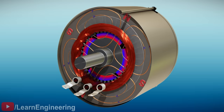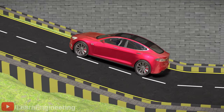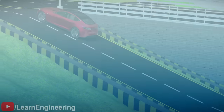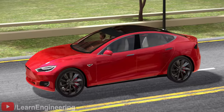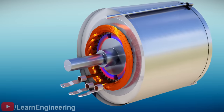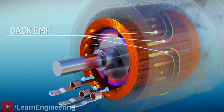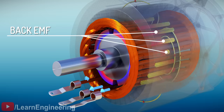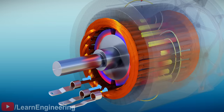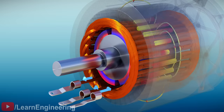But the search for the perfect electric motor is not over yet. A permanent magnet motor produces good torque when you start the car or ride up a hill. However, when the car cruises down the road at high speeds, permanent magnet motors have terrible performance. The villain here is the back EMF. The magnetic field lines produced by the permanent magnets link with the stator windings and generate an EMF there. This back EMF is clearly a reverse voltage to the stator's supply voltage — the higher the rotor speed, the more back EMF is produced. Moreover, these high-strength magnets also result in magnetic eddy current losses, which increase the heat in the machine.